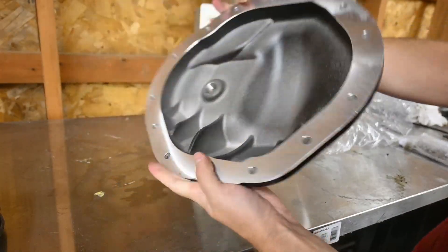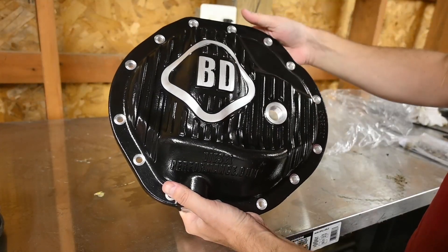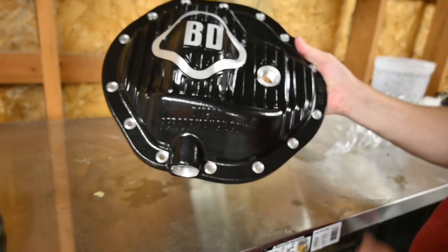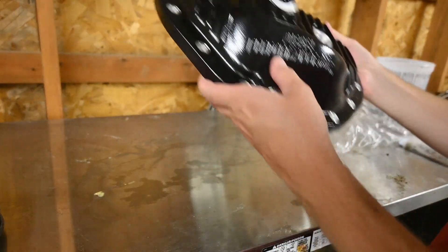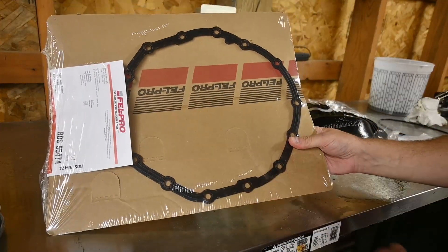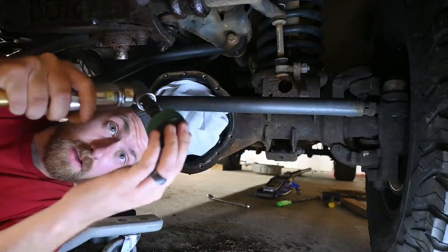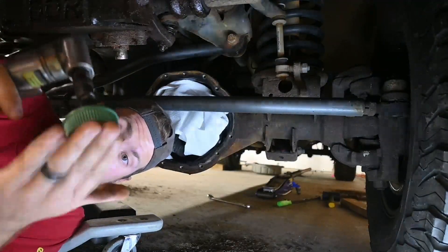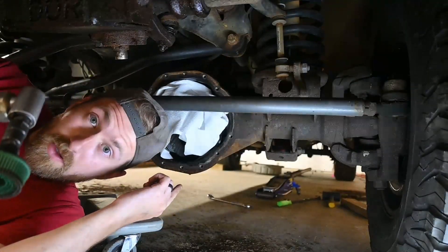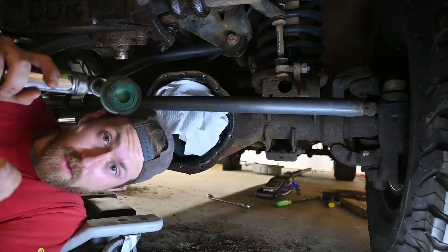This adds a little extra capacity — I think with this it ends up being two and a half quarts of fluid. Just like the rear one I have, I've got the drain and the fill so I don't have to keep taking this on and off. Got the whole new cover and also picked up a new gasket — hopefully I never have to take this off again, so no need to use the old one. This is my new fun tool: a nylon bristle brush in a die grinder, which cleans the gasket surface without gouging the metal, so you don't have to worry about screwing up the surface.